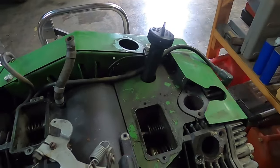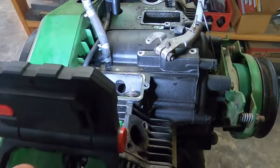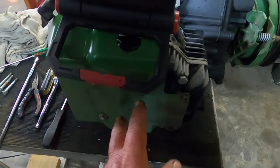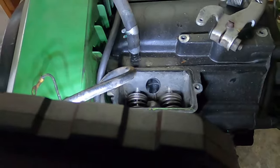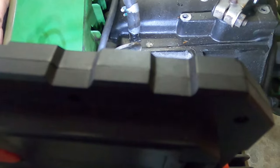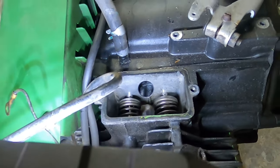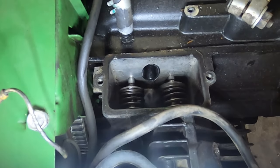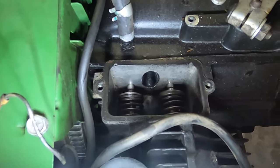At the end of the video, I'm into the valves, so now I can do some adjustment. Because of the way these engines are configured, it's kind of hard to find top dead center — the plug hole is such that the piston is right here and you can't really see down in the plug hole. But what you can do is look down the hole in the breather — the valve cover assembly — and you can see the bottom of the piston rod. Turn it to where you can see it and the piston's all the way up: that's top dead center. That's how you find it.